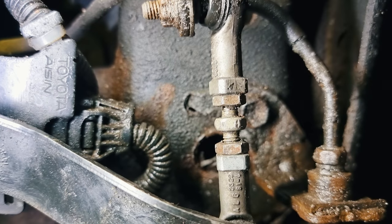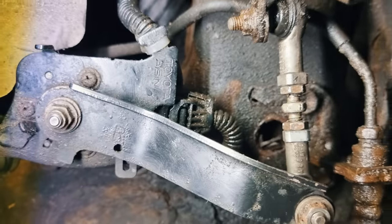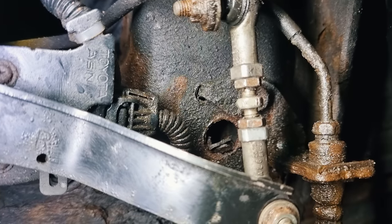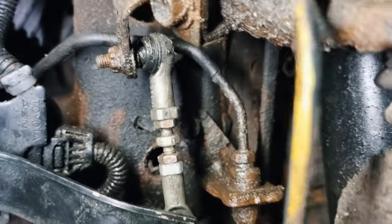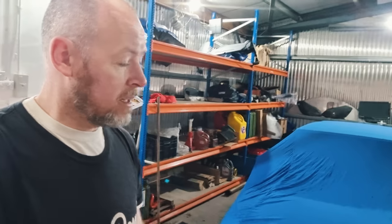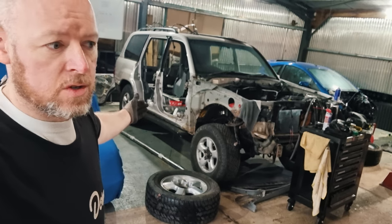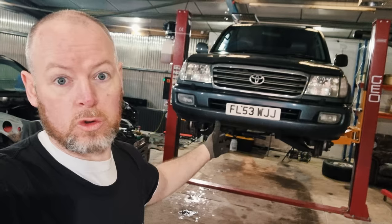You can take the ends off and grind them down a little bit to get those extra three millimeters, but there's a chance you'll burst the reverse thread, so I didn't think it was worth it. That's how it should look at the end — everything's tightened up and the lock nuts are all snugged down so it can't work itself loose. If there's anything else you're interested in, let us know and I'll try to film an instructional guide. We've got a spare Land Cruiser here, which has been good for learning on, and now we're applying it to an actual good Land Cruiser. Let us know if there's something else you'd like us to show you.